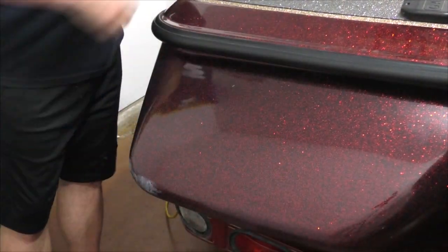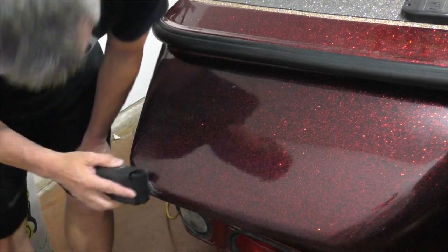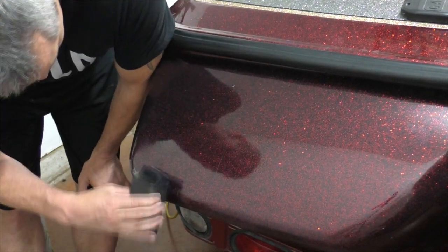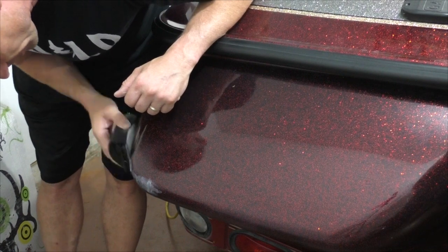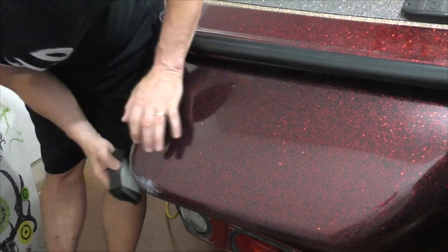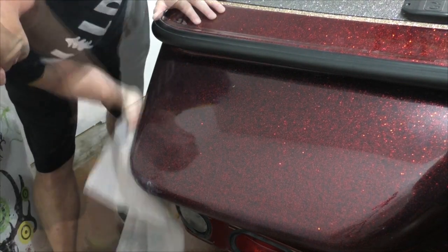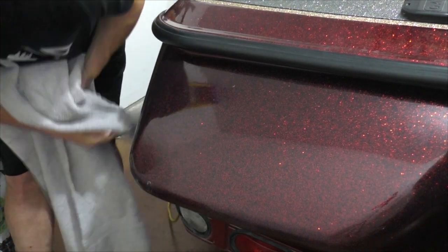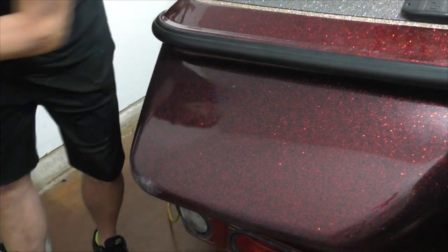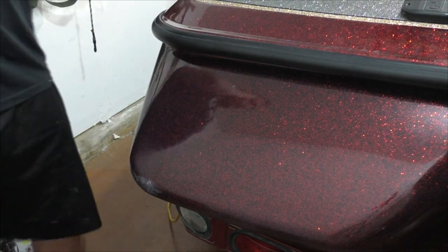I don't know if you can really see, but that's actually a hole right there. The area I'm doing — I'm using 600 grit just because I don't want to get too aggressive. You can kind of see it gets nice and white, and you want to get all of that. I'm going to put bondo in there — there's another big scratch over here. Get all that dust off, tape it off once it's dry. You can see it's sanded, it's not real smooth — that's how the stuff's going to get in there.